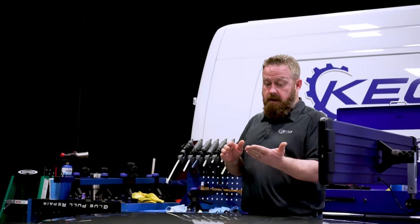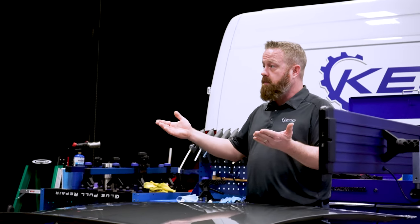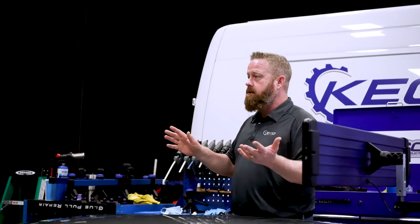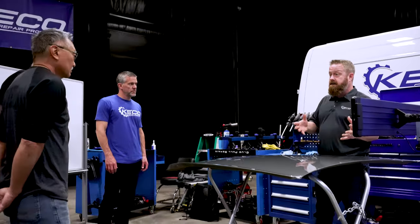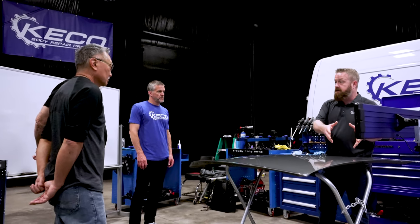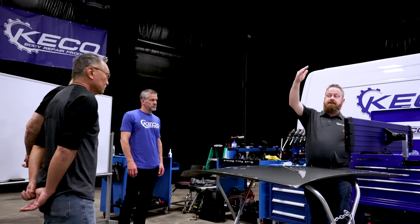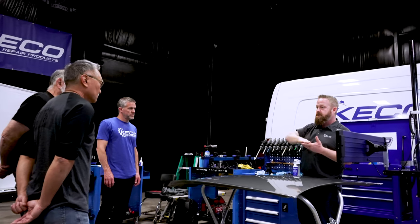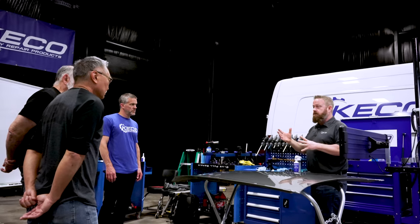I'm going to have you get this close enough that we can block that with our 800 or 1000 grit. And then when we come back in with the two coats of clear, the dent would be gone, or to a completely unnoticeable level. Now, that is not a paintless repair, because you need the thickness of the clear coat to finish it out. As you chase your craft even further and move up to the very top right, that top right pixel we talked about on the screen yesterday, this is the foundation to move there.